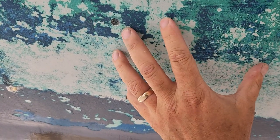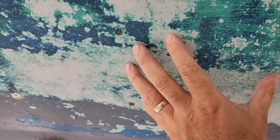I wanted to do a quick video on soft spots on the bottom side of the hull. I just bought this — it's a '96 Angler, 21 foot. I checked all the sides, it looked good, everything felt solid, transom's good. But I was under here getting ready to paint it and I noticed that this was kind of soft. When you push on it, it would move maybe a half inch or so with not a lot of pressure, which was a bit of a red flag.